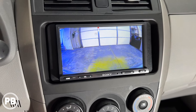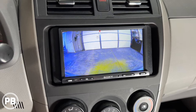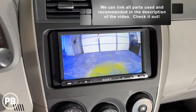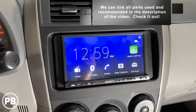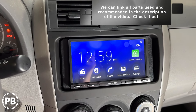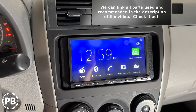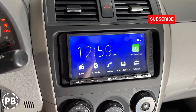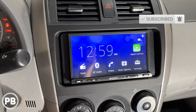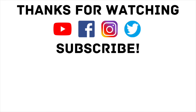The downside of option two is that we had to pull that extra purple wire as a trigger from the reverse light positive all the way up to the radio, but the extra labor came out really nice. If you want to see how we did the radio install, that video is linked in the description, along with the front speaker and rear speaker install as well. Thanks for watching — hit like if you enjoyed it, subscribe for more great content, and we'll see you in the next video.